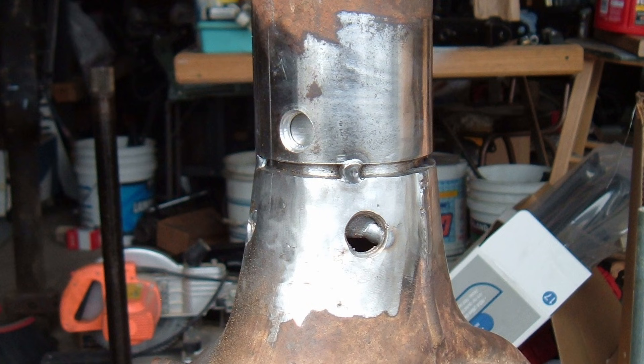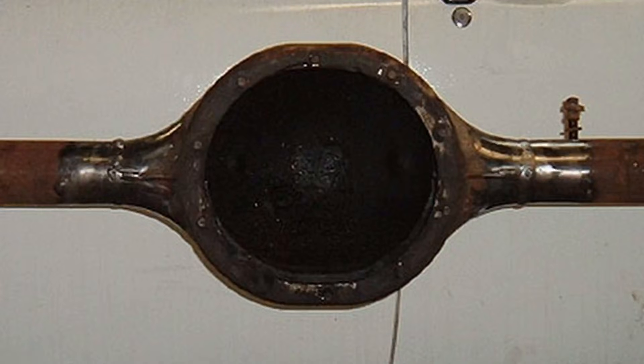I've done this on a couple of housings. The second housing I built used a period-correct 60s center section with the 8-inch tubes welded to it. In that case, the tube diameter was the same for both the 8-inch and 9-inch axle housing tubes, which meant I couldn't easily slip the 8-inch tubes into the 9-inch housing like I'd done in my first build. The 8-inch tubes also weren't long enough to completely remove and press in the original way. So what I ended up doing was sleeving the axle tubes, using plug welds with a small gap so the sleeve was welded to both pieces — resulting in a super strong rear-end.